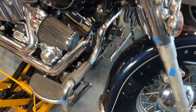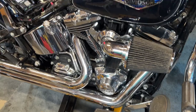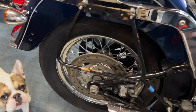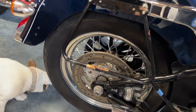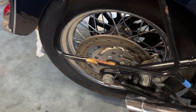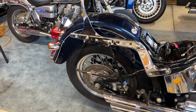He wants a new black crash bar. He wants to leave all of this chrome on there. It's a 103. The brakes are bad — I'm probably going to have to change the rotors because those rotors right there are really uneven. So I was going to have these brackets back here, the saddlebag brackets, powder coated again because the paint or whatever started coming off there and rust set underneath it.